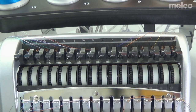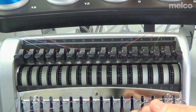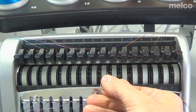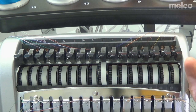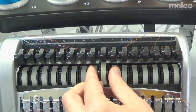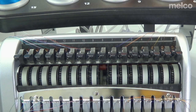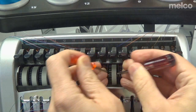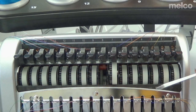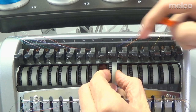Now I need to remove the thread feed rollers. In your operator's kit, you'll get a tool that looks like a little ring with a little hook on it. You can take the tool, line it up on the edge of a roller, rotate 90 degrees, and then pull. If you pull out at a 45 degree angle from the front of the machine, it makes it a lot easier. If you don't have that tool, you can use two small flat blade screwdrivers — go in on either side and pry it out, aiming towards the middle of the curve at a 45 degree angle from the front of the machine.